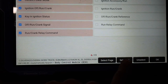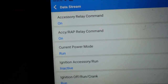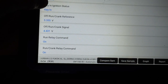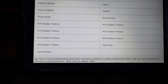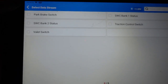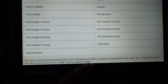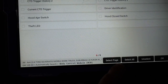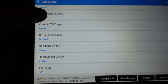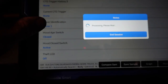Selecting all in the data stream. Accessory relay command is on, current run mode — power mode is run. Going to start, we should see a crank request. Looking at theft data — CDT status is disarmed, and it says the hood is closed, but really it's open and active. The BCM shows the theft LED is off — that's really interesting. Let's double-check that.